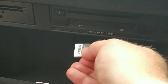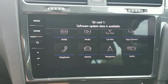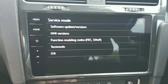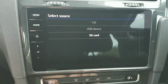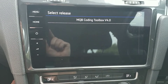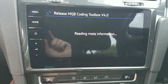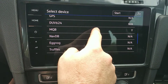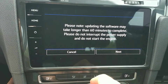Take the SD card, plug it into one of the slots — I usually use SD one. The screen should show that it sees an update. Hold down the menu for about three to five seconds, go to software updates, versions, and update SD card. The toolbox is reading — great, lots of things that it doesn't have. There we go, MQB is going to install. Yes, start, next.